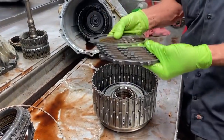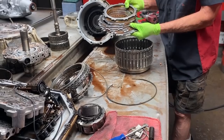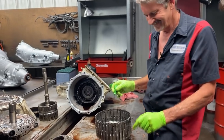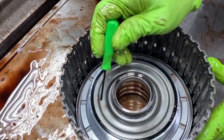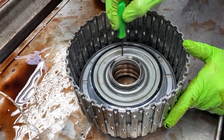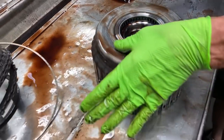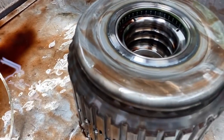Get our 1-2-3 pack — you can see four punches here. You can see we're starting to get wear here, starting to turn dark. These overhaul kits will come with all the seals and stuff and your bonded pistons. The rubber is usually sticking out around the snap ring through here. When you take this apart, you do want to air check this for any type of cracks. Since the clutch isn't burnt up, I doubt there's any cracks, but when you do air check it you will get a little tiny leak — there's a little tiny hole somewhere around here that you will hear.